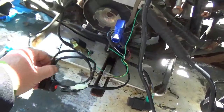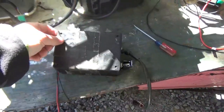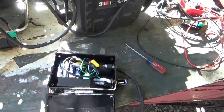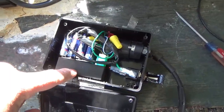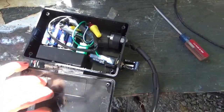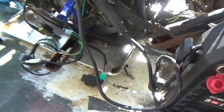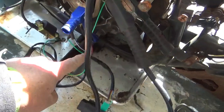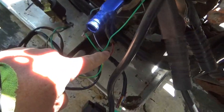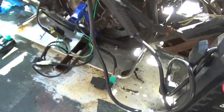So far this discussion has been about the pit bike AC CDI setup. Now I built this portable box — the only difference is this CDI runs on 12 volts and you see those batteries there, they're what you use to power it up. Believe it or not, the wire harness is exactly the same. To power it up, you put 12 volts on the black and red and the ground goes where the green goes.